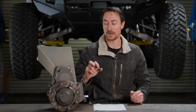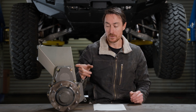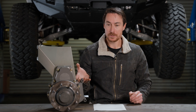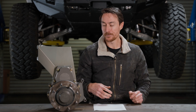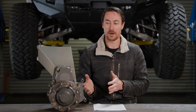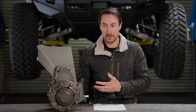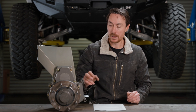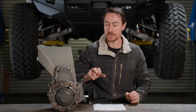And it was an evolutionary process. Originally, the Unimog stuff is a cast iron housing with a two-gear gear set into a forged steel knuckle. The knuckles were always pretty strong, but the gears would blow out the boxes. So we made a box for it, slowly started making additional components for it. The original Unimog stuff actually ended up in a race car, and it kind of developed out of that. We found we had replaced every item in the box and the box itself, with the exception of the gear set, developed our own gear set, and had a two-gear version. Then when we started moving everything to unit bearings is when this kind of developed.